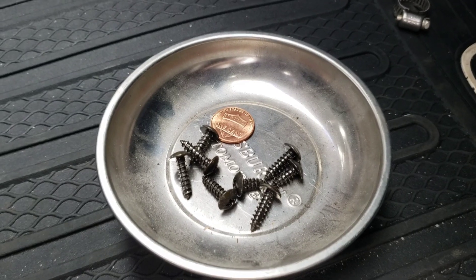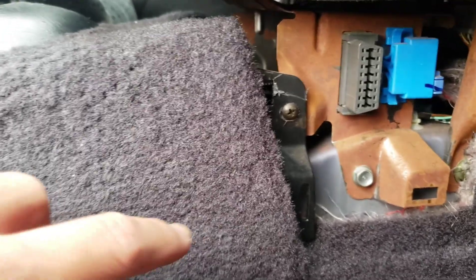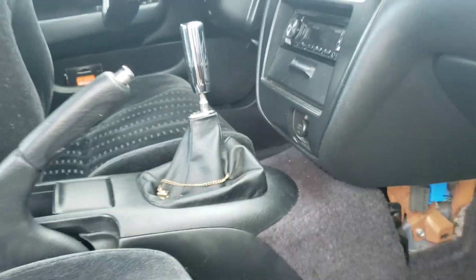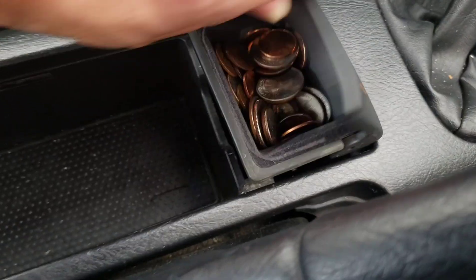With eight screws and a penny removed from both sides, this should slide right up. I tried pulling it back up and found that right here, behind this carpet piece, is actually where your OBD scanner goes — for those who don't know, on a 99 Prelude on the passenger side there's a piece of carpet covering that. There's just another screw holding it here — get your coin jar out — and now it should come right off.